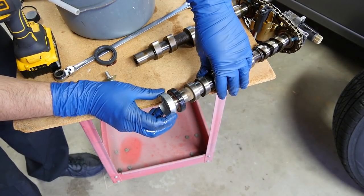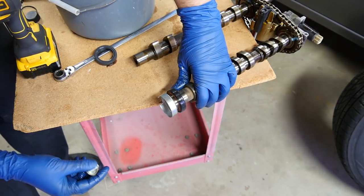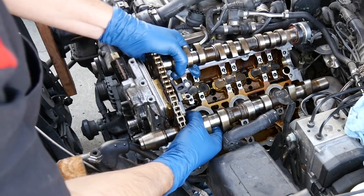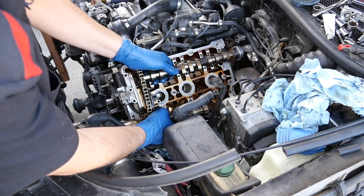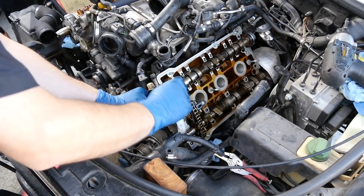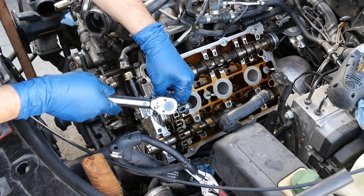Slide on our new camshaft seal and put on the camshaft sensor cap — it can only go on one way, which is the only way you should put it on. Torque it down to factory spec. Next we'll bring everything over and set it down, trying our best to put the camshaft chain tensioner on nice and even. Run down the bolts little by little, then torque them down to the manufacturer's torque specification, which is seven foot pounds.